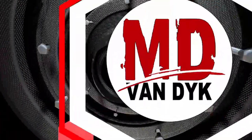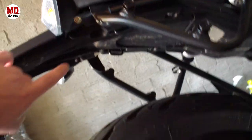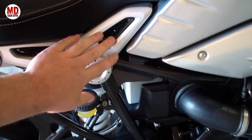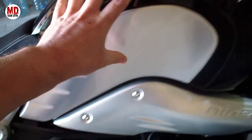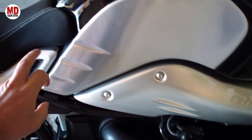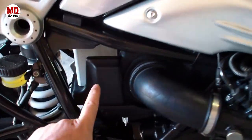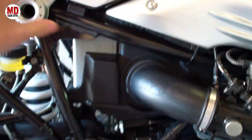I hope this helps you out, so stick around. First, we have to take off the back seat — there's an Allen key bolt right up here to remove it. Then we take off the front seat. We also have to remove these decorative pieces on the sides. There's a bolt over here and two under the seat. We need to remove the tank as well, and you can't lift the tank with these on. There are bolts that hold the tank on right over here, and then once the tank is off there's a bracket that holds the battery underneath. Let's get into it.